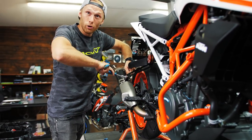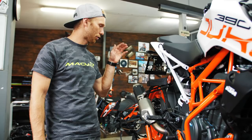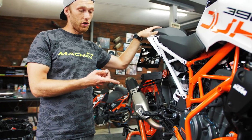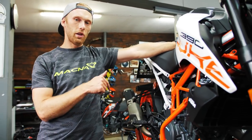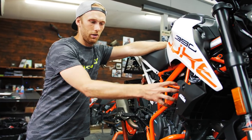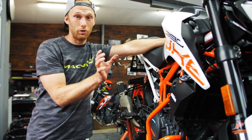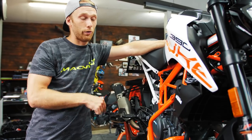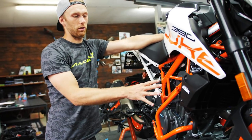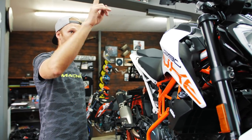So if you have the sub cage, what else do you need? Good question. Our sub cage protects the rear part of the bike — the exhaust, the plastics. For the crash cage, I have the KTM Power Parts version. I'm not a fan of frame sliders — the ones that just stick straight out — because they destroy the frame in the first crash. Please don't buy crash sliders for your Duke. Get a full crash cage instead, because it has three mounting points and absorbs impact much better.